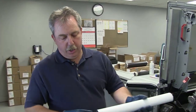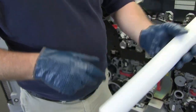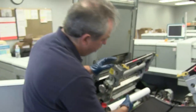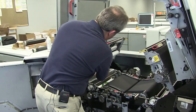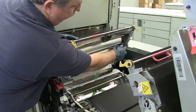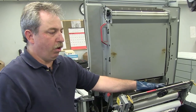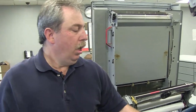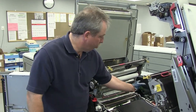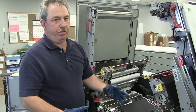For your new sheet cleaner, you've got the straight pin on one end — it has no groove — and then you've got the side that has the groove. Put the straight pin in the front; it doesn't have to lock into anything. That will allow you to move it back and forth if needed to lock it in place on the back bracket. Once that's locked in place, this side is all done. On the primary side, the groove will be on the front rather than the back, but the steps are the same.